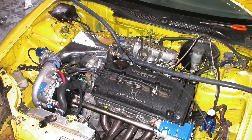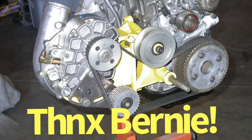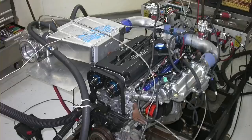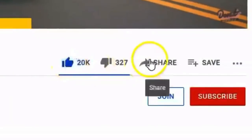The Vortech supercharger is very cool — we ran it on a lot of different combinations, tried different pulleys, and made a ton of horsepower. I even put together my own combination remounting the blower without the jackshaft down near where the air conditioning is — trying to run it at Bonneville — and it worked very well. But what everybody was waiting for was the high-horsepower turbo deal: 30 pounds of boost on a modified motor. A good-quality powerful combination added to boost — that's a match made in heaven. Like, share, subscribe, ring the bell — I'll keep testing.